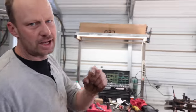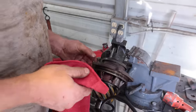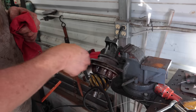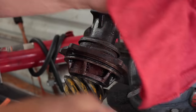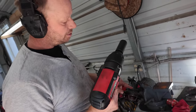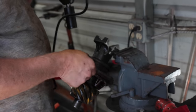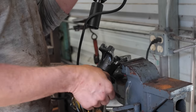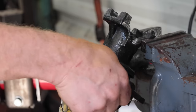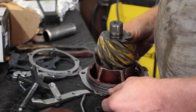So we never crushed that sleeve because that race wasn't in all the way. We had that extra gap, so now I can crush that sleeve. Jacob thought it was working way too soon. Now that's not enough rolling resistance. We've got to go a tiny bit more, and it's all that this gun can do. If you don't have it in the vise, it kind of rattles. So right now there's no free play, no space to go in between. Just need to tighten that up a hair yet. Best thing to do is try to find numbers on your socket and then watch them spin, but don't let them go too far. There we go. Just a tiny bit more resistance than freely spinning it. That's what we want. I am 100% confident in that. So we'll just start with one new shim.